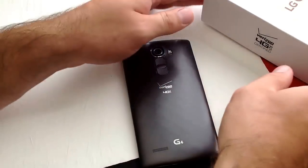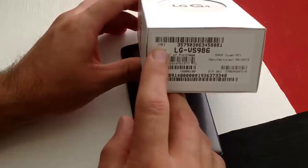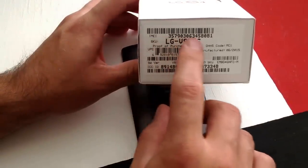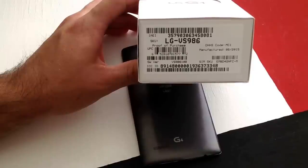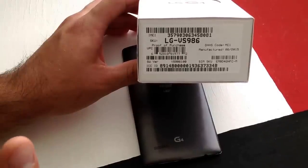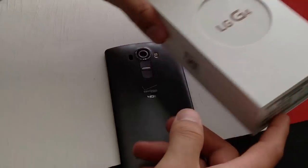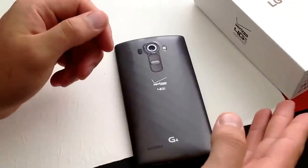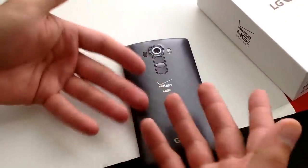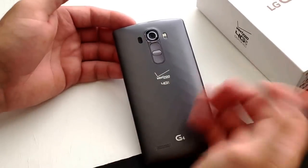The first thing you want to do — if it came with the original box, I bought mine from the store — so I have my IMEI right here on the label. The IMEI is the top number. I usually go to freeesncheck.com. It'll ask me for the carrier — Verizon, AT&T, T-Mobile, Sprint, that sort of thing — and it'll ask for this IMEI number. Type it in and it will give you the status of the phone. I wouldn't always rely on the label on the box, especially if you're buying it used. Somebody could have switched out a box and put a stolen phone in a clean ESN box.